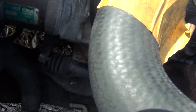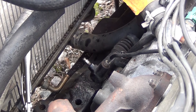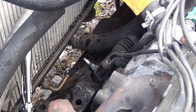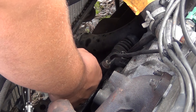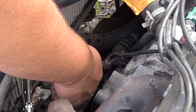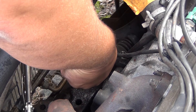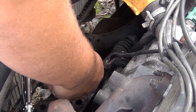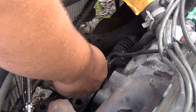What you want them to do is pump the pedal five times, and then open the valve. Have them hold it all the way down, open the valve, then close it quick and let the fluid spray out to get all the air out. Then pump it again.